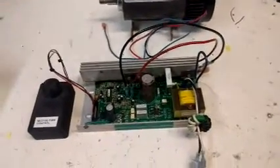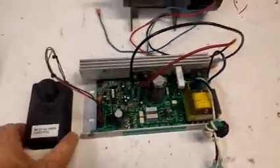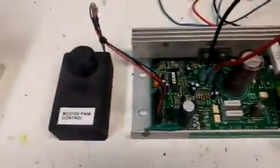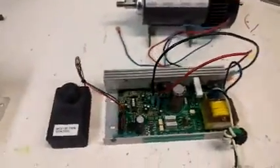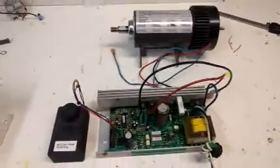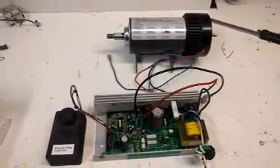Here's the test setup. I have what I thought was a bad MC2100 board. This is the test box and you just plug it into the connector where the front panel would have plugged in on the treadmill. There's the motor, I've got a switch over here, and I've got the pot set all the way up. It's been off for a while, and what you can hear now is the thing ramping up to full speed.